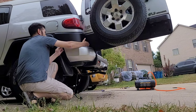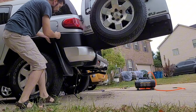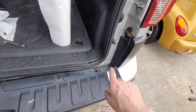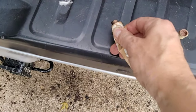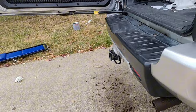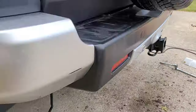Position it and then shove it in — that clip's in. Replace your clip that went in this hole here, and the five screws across the top, and the four screws underneath. I'll add just a touch of anti-seize to each of these. Here's the trailer hitch fully installed — definitely tucked in a lot better than the previous version. Subscribe if you want to see part two of this video where I remove the old wiring and replace it with new wiring from Toyota.